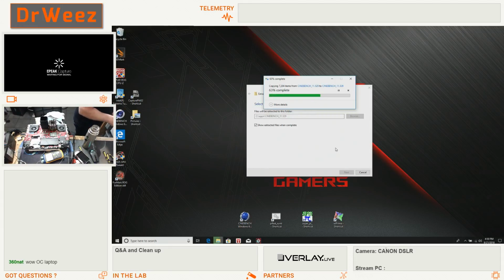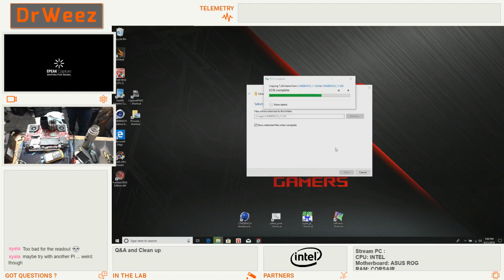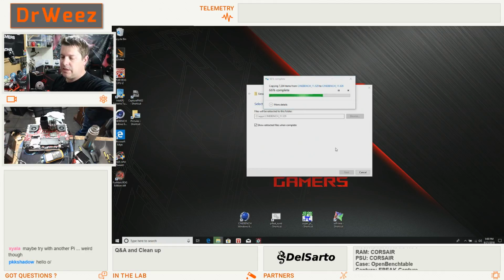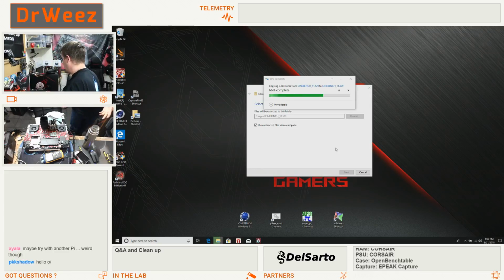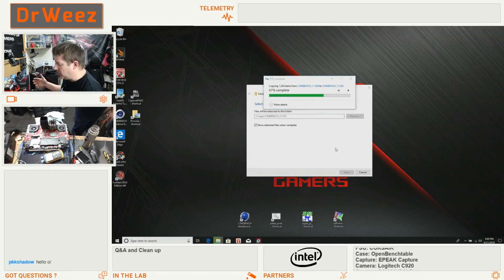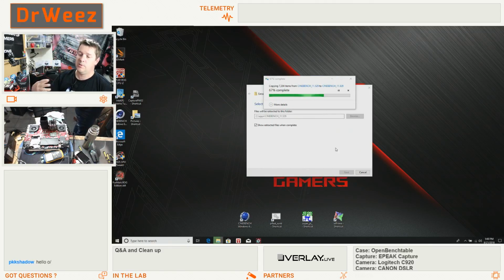We really don't need to go terribly cold. The boost from going from ambient temperature to minus 100 really didn't do much, because you're limited by the controls and the overclockability. Stupid things, well, what we consider stupid things as extreme overclockers, like your over-voltage protection, so your voltage throttling. You can't disable that. So even though you're going cold and you can handle the voltage, you don't have control over removing that limitation. And for good measure, it is a gaming laptop, so you shouldn't be able to bypass some of these protections, because typically you won't be putting liquid nitrogen onto your gaming laptop. I mean, this warranty is so voided. I had to break about 6 warranty stickers to open it up and get it to this point. So typically you won't be doing this, and you need to have that protection in as a manufacturer to make sure your product doesn't go up in smoke, right?